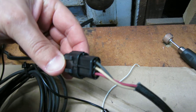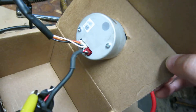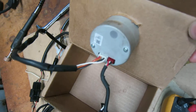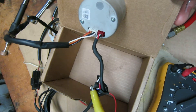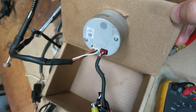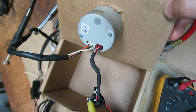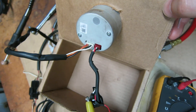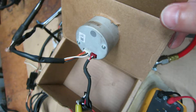There are three wires on these senders: a red, a white, and a black. The Defi sender connects through an intermediate wire, and on the back of the gauge itself those three wires come into a red connector. The red wire on the far left turns out to be a 5-volt reference voltage that comes out of the back of the gauge. Black is just ground, and white is the signal coming back from the sender — that voltage drives the needle itself.